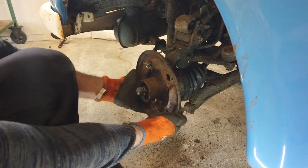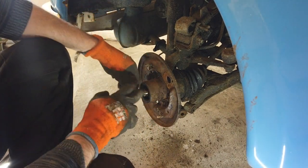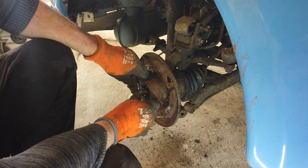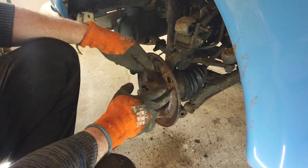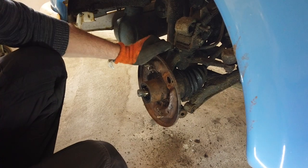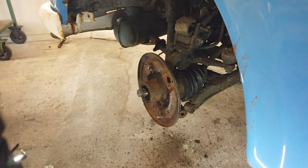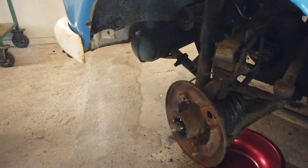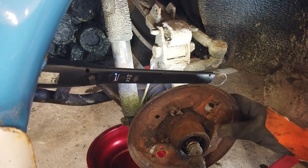I should be able to pull this assembly out. Next up - because when I took off the drum I hammered this axle stop backwards, so that is already loose in the bearing. There is a chance that this bearing is damaged, and it would be really nice to change it now if it was, but I don't know if it is. So next up is to get something to drain the oil into, if any oil comes out. We're going to use this and put it underneath the gearbox right where the shaft goes into the gearbox.